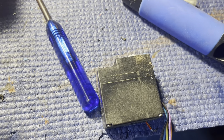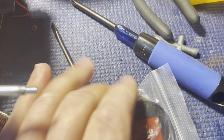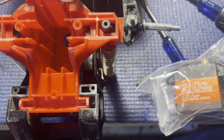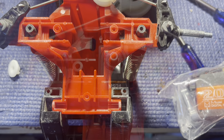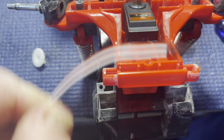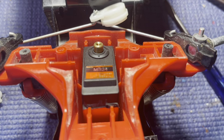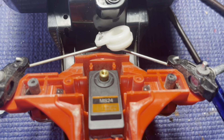There's our stepped servo with no legs. Other than that it's basically the same identical size as a regular servo. What I'm going to do is cut the legs off, put the wire up through the hole, and we'll go from there. We're going to have to hook this up to something to center the servo first. I haven't centered it yet but I got it shoved up in there — the wires going through the hole come out underneath, which will run up into the chassis to hook up to the receiver. Pretty straightforward how these work — they're a pretty easy conversion.